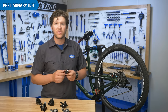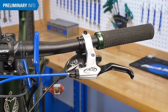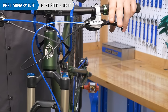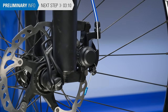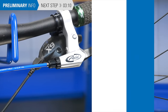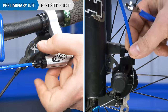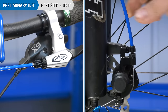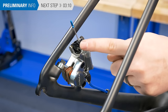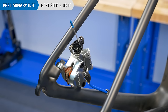Let's go over the key components of the mechanical disc braking system, including the things that distinguish it from a hydraulic system. The brake is engaged by a brake lever at the handlebars. On a mechanical system, the brake lever pulls a cable, which runs through housing down to the brake caliper. The housing can effectively be lengthened or shortened with the barrel adjuster, which may be found at the lever or the caliper, or sometimes not at all. Note that the TRP Highroad caliper uses hydraulics in the caliper body to move the pads, though actuated by cable pull — for pad alignment purposes, it is considered a hydraulic brake.